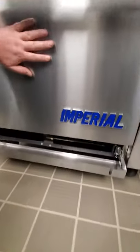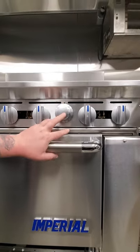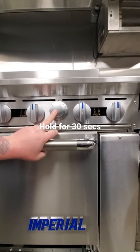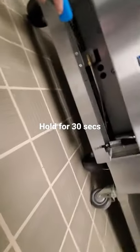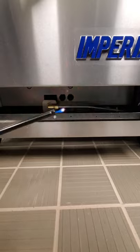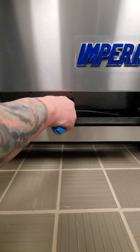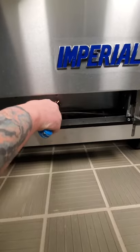How you want to light your oven is you want to come up to your knob and turn it to pilot — this is just like a furnace. Then you're going to want to press that in, and come down here to this second hole right down here. Get your lighter lit and stick it in that hole and light your pilot that's back in there.